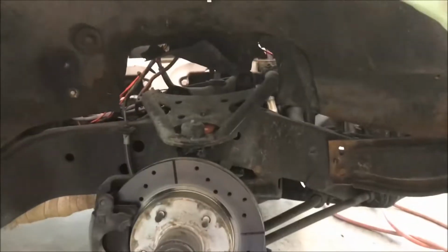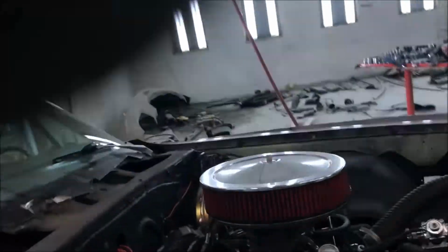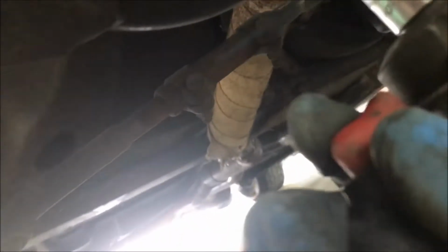Take your wheel off. Alright, now go from the top side. We're gonna get that bolt right there. See it? We're gonna do this by setting my phone down and using 2 hands, just like you can see there. Got it from the top side. Straight over here. Got that little goober off. Done. 2 bolts down here on your strut off.